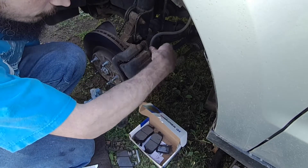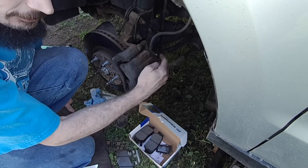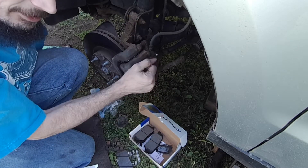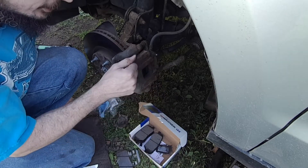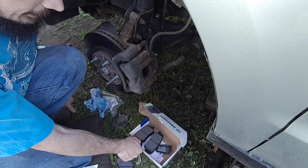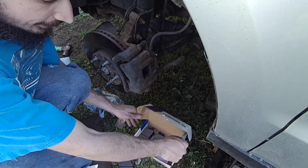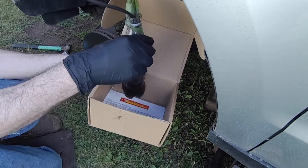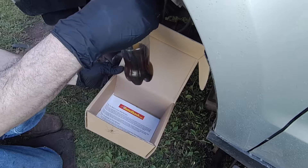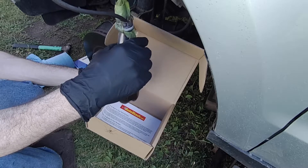Now I'm going to take it a step further. I'm going to take the cap off the bleeder, loosen up the bleeder, and bleed this caliper out to get the old brake fluid out, since I've already flushed my reservoir. It's 10 millimeter on that bleeder. I've got to get my one-man bleeder set up on there first. The only trick with this — it's just an old pop bottle with a washer fluid hose going into it — but it needs to have brake fluid in it. That hose needs to be submerged in brake fluid so it can't suck air into the brake system.